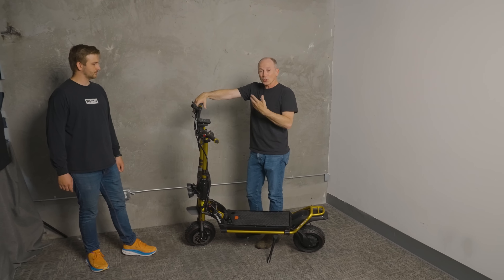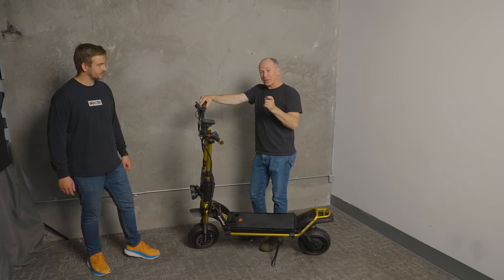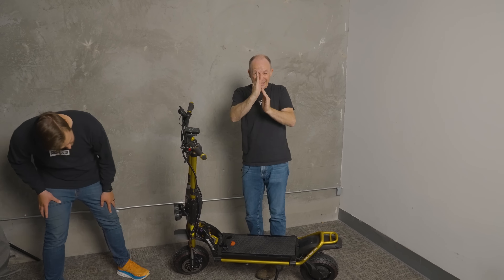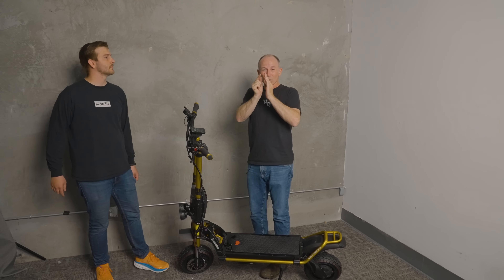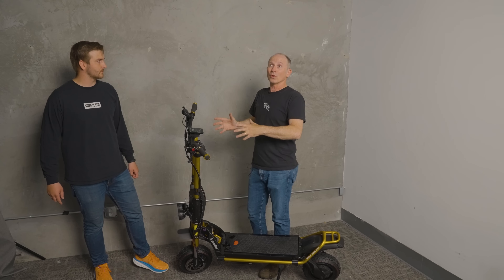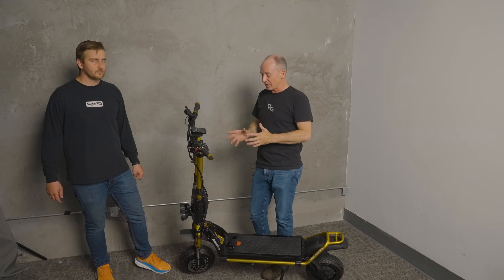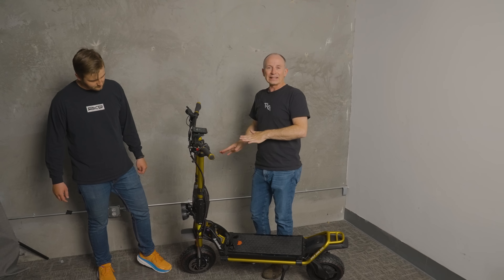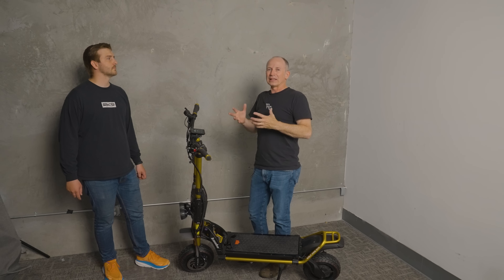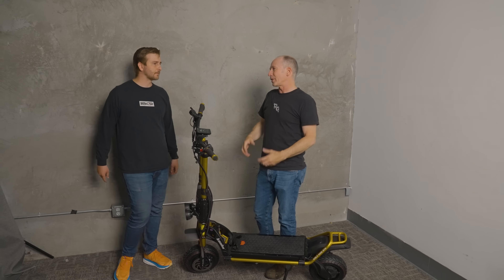The brakes are still Zoom brakes, which is what we've seen before, and they look like they still have the big thick rotors. Most scooters have rotors about 1.6 to 1.8 millimeters wide. The Wolf King GT Pro rotors are like 3 millimeters thick — the first ones we ever saw that thick. These look at least that thick, which just feels better. They won't warp, they won't bend, they don't heat up as much — you can work them a lot harder without overheating them.